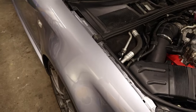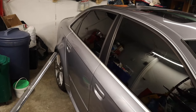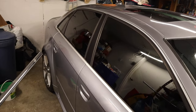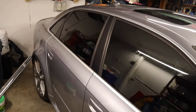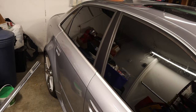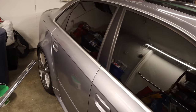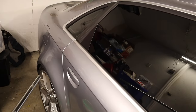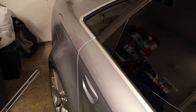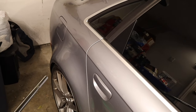He mentions in that video about the tires. Look at my car — I kept this car on 255s. People do 265s, 275s, and they get away with it. But on that Sprint Blue car with the BBSs — even if those BBSs are 255/35/19s, which is the stock size on this car — whoever had it previously most definitely put spacers on it, because you can see how far out they were, and like he shows, it has been rubbing and there was a whole bunch of rust there. I kept everything to 255s inside the fenders. That car also — one thing he didn't mention for the suspension — still has DRC. So there'll definitely be an interesting coilover series on that car. I got KWs on this and I love them.